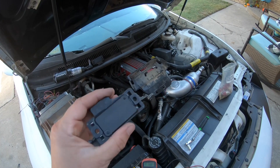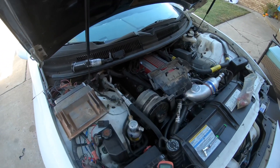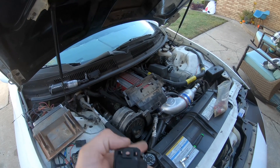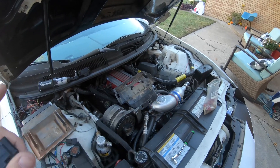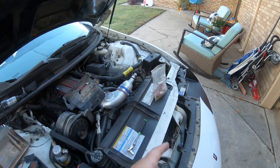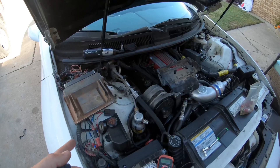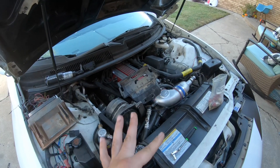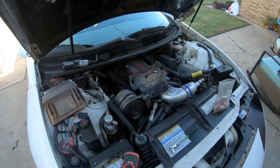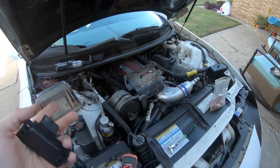It's all working now with a one-bar MAP. Today I'm going to swap in a two-bar MAP from NAPA. I'm gonna go tune it — no wide open throttle stuff right now, just driving around. I gotta swap in his 65-pound injectors because we're gonna run E85 on this thing. I'll wire up a sensor and all that later, but I'm gonna get it dialed in on 91-93 octane first and go from there. Let me get started on these injectors — shouldn't take too long.